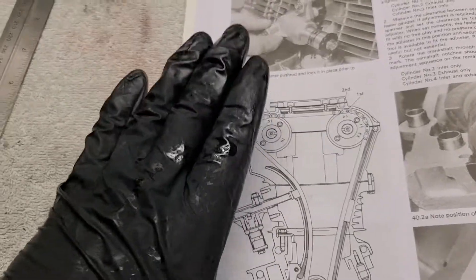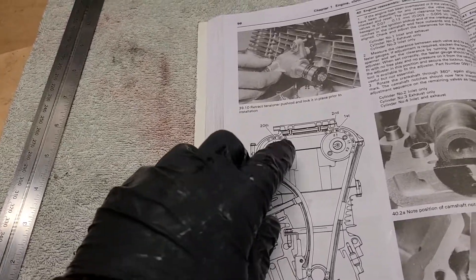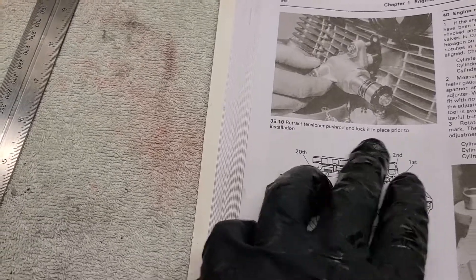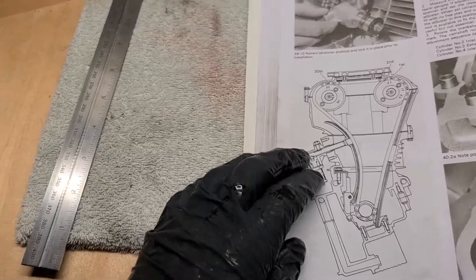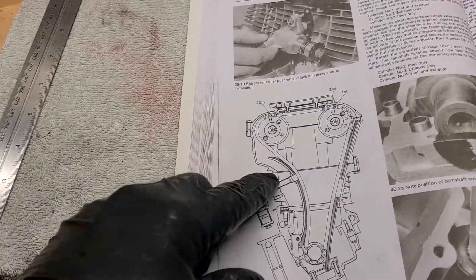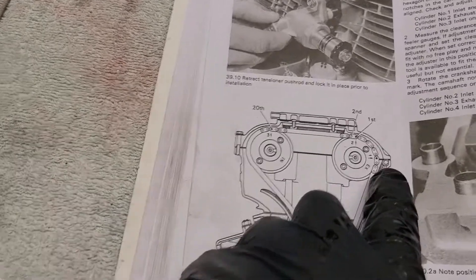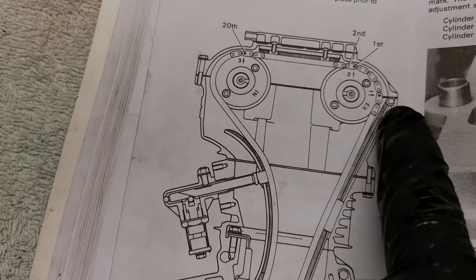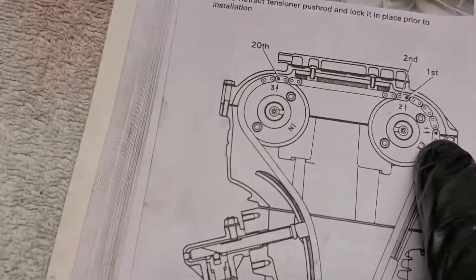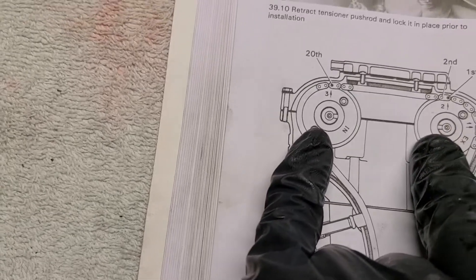Per the manual, this is what you're looking at — you're actually looking at the right side of the engine. You've wrapped your chain around there, gotten it tight. Prior to adjusting this, you want to put your cam chain adjuster in there first, because you want to make sure the chain is taut. Otherwise, what happened to me is I wrapped the chain and it was actually off by two notches. You want the arrow at the top base of the cylinder head, the two straight up, the three straight up, and these two notches right here facing each other.